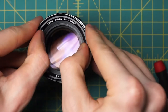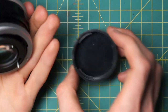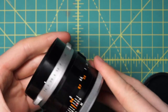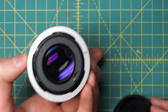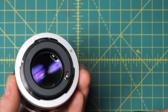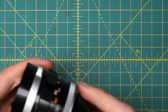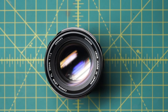That has the entire reassembly complete. This lens is overall not too difficult to take apart and very repairable — it uses higher quality internal components. The one annoyance is getting access to the back of the diaphragm is more difficult than on some other lenses because you have to remove the optics, and you have to be careful when putting it back together or else you can end up with little fractures if you press on the optics the wrong way during reassembly. But overall it's not too hard and it's a very repairable lens.